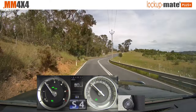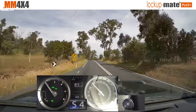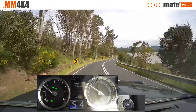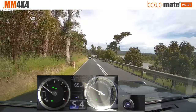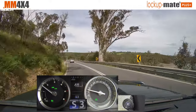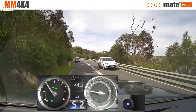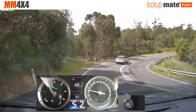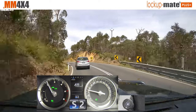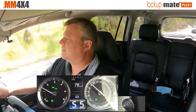It's an 80 zone, so I put it into fourth gear. As you come into the corners, if you just left it in S4, as you've seen before, it just unlocks. But if you want to keep it locked up and keep that nice manual gearbox-like feel with precise power, you just downshift before the corner. Here I'm coming to a slower corner, I just downshifted into third. If it's any slower, I'd probably go into second. The LED is still on, so it's still locked. I'll drop it into second here. Coming to this corner, it's still locked. Then you can power out of the corner — very precise power control. When you're driving like a clutchless manual, it always puts a smile on my face — just a great feeling with this nice V8, getting all that power onto the road.